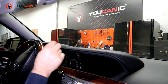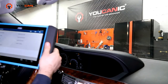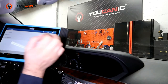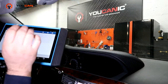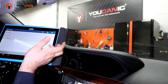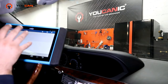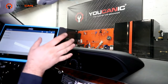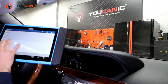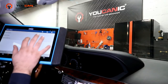First, let's see how you troubleshoot and find out which of those damper solenoids is faulty. You have to use a scanner that's able to read fault codes on a Mercedes and also read fault codes from the air suspension compressor. A generic OBD2 scanner won't be able to read codes from that. Here we have this scanner, but some people use the Star Diagnostic scanner used by dealerships — the steps and procedures are almost the same, so by watching this video you'll be able to do this with any other professional scanner.